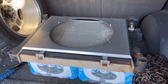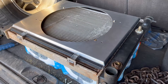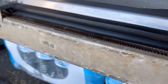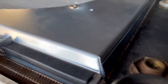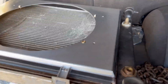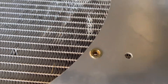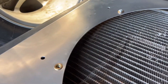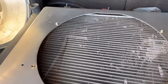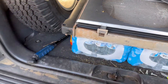I've got the fan shroud fully assembled and ready to go back in the Jeep — this is still on the test radiator. I've got your foam gasket down at the bottom that seals up the airflow completely, and the nice rubber pieces all the way along the edges. The nut certs have been put in place for screwing the electric fan in nice and easily, and I have an aluminum piece to go across the top of the radiator. Let's get it mounted.